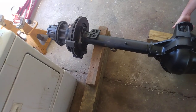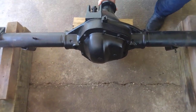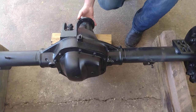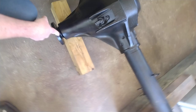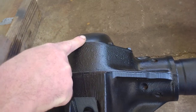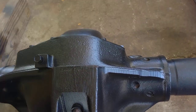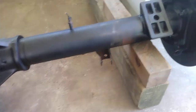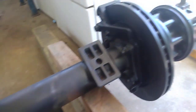The special part is it's got a forged track lock on it, and the clutches in it even look good. We pulled the front pinion flange, checked the bearing, and changed the seal. We pulled the rear end cover, painted up the gears, and checked their match pattern — they all look good. The rear end is full of fluid with limited slip differential fluid, and the wheel seals do not leak.